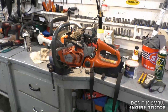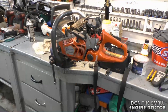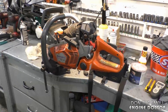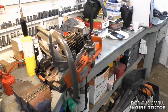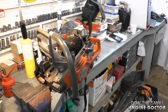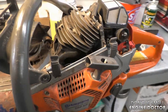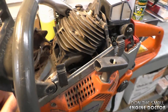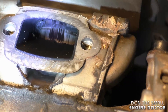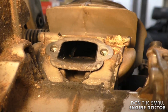Welcome back to my channel. Just a quick video today to show you why this Husqvarna 562 XP wasn't running right. These are excellent saws, by the way. This saw did run, but it did not idle properly and did not have the power that it should. As some of you may have guessed, there is an issue with the piston and the rings — you can see that the piston and the ring are scored.